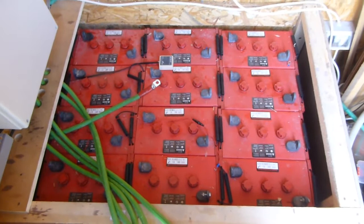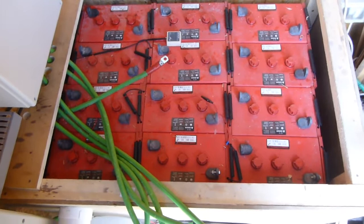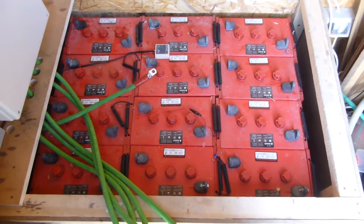While the battery is disconnected for a couple of hours, it's also a good time to check the individual voltage of each battery, because then you can see if any of the batteries are going bad. If one of the battery voltages is a lot lower than the rest, you know that battery is having an issue and the others are propping it up.